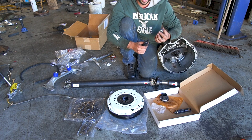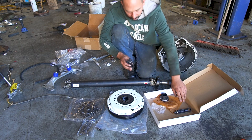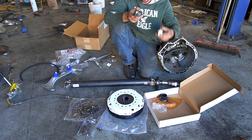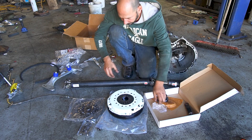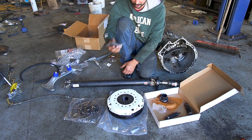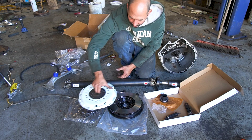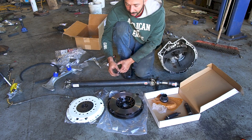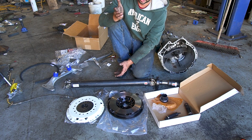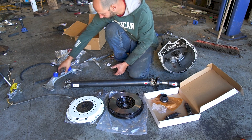You're going to need a pilot bearing since there isn't one in there for a manual swap. A lot of kits come with two — the bigger hole one is for the ZF, the smaller is for a Getrag. You'll also need bolts for your flywheel install. If you're using a single mass flywheel you can reuse the auto bolts. If you're using a dual mass, you need the longer bolts specific to the dual mass — they're quite expensive from BMW, so don't lose them.